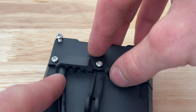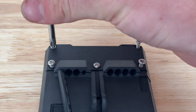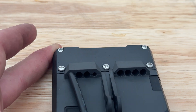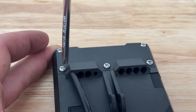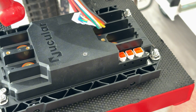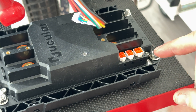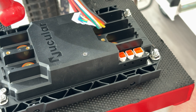Now I'm just going to reinstall the cover on the back of the display. Just like the mounting brackets on the controller, you don't have to worry about going too tight — just make sure it's a little snug. Now coming back to the controller, we're going to plug all the wires into it. We're going to start by removing these little white and orange connectors. These are just plugged in now to prevent any water from going in there, so the ones that you do not end up plugging a wire into, leave the white and orange plug in there to protect it from water.